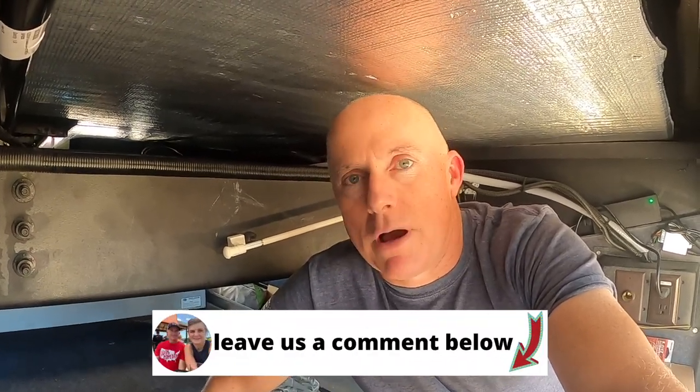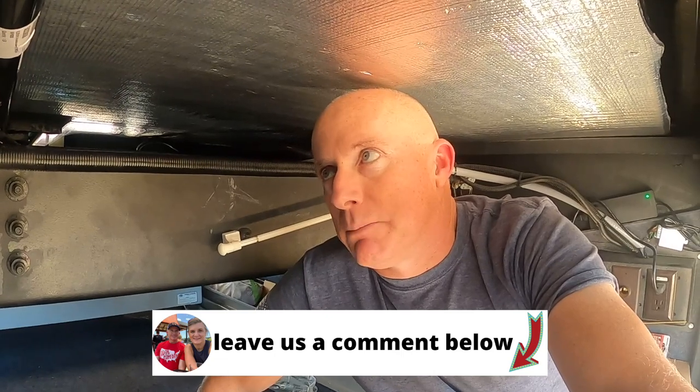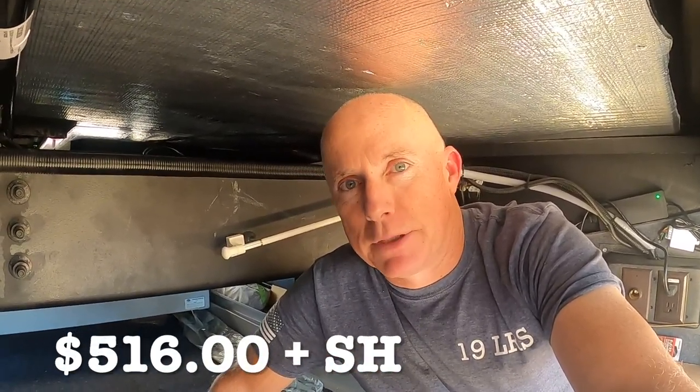It wasn't an o-ring, so it wasn't something simple like that. It was actually a weld issue where it came apart — how it happened, no idea. I'm going to talk to Tiffin when I get back there, but the guys at Tiffin's hydraulic shop told me the steps I needed to do. I did buy the cylinder from Tiffin — we'll put the part number in so you guys will have it. The reason I bought it from Tiffin is because Lippert didn't have it. HWH is the actual cylinder manufacturer and they didn't have them or an ETA. So it's $516 plus shipping, but I tried to get it fixed and had no choice but to replace it.